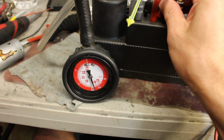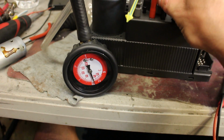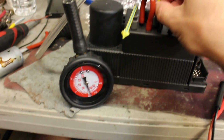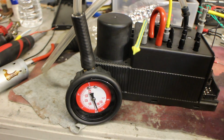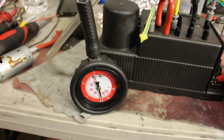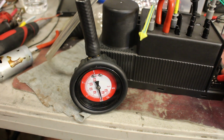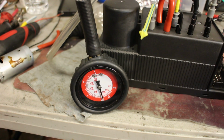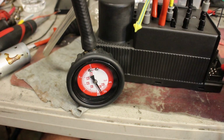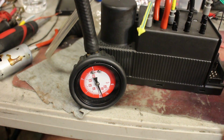And we're coming back to our door lock circuits. I'm going to demonstrate it on the trunk circuit. This is much more visual, because the trunk circuit has a single solid actuator, and pressure and vacuum show very well. So lock and unlock. Pressure unlocking, as you can see, activates nicely. Locking, that was vacuum. That's lock. Lock and unlock. Unlock, lock.